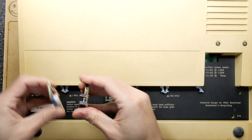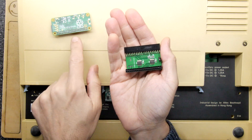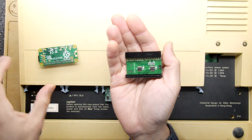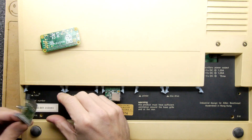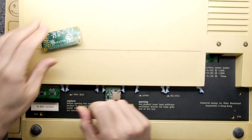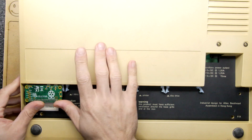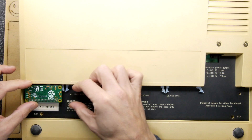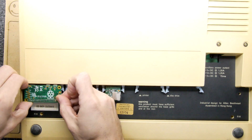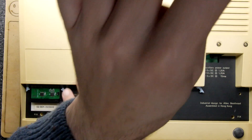Just to show you while this is flipped over how to install the Pi Tube interface: you really just pop that in — you can take the Pi out. Same sort of way, you just pop it in. This jumper selects whether the BBC is powering up your Pi or if the Pi is going to run off its USB. On a Pi Zero you won't get the USB ports once it's installed. There's no keyway on this one, but you really can't go wrong. Both of these interfaces can be attached remotely if you've got the appropriate cables. That part of the interface is just a signal level converter for the Pi, so you can leave it in — it shouldn't affect the boot up.